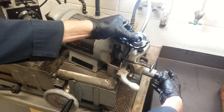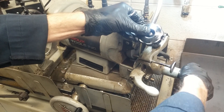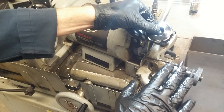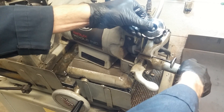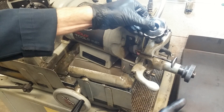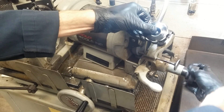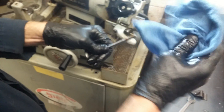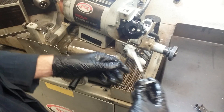You want to move that back and forth across the stone, so I'll move it in there close. Make sure the oil's on the valve. Again, I go slow — the whole idea here is the less material I can take off this valve and make it true, the better. Just barely contacted it, back and forth. I'll back it off so I don't drag it across the stone as I'm pulling it away. Now if I were doing all of my valves, I would do the tips at the same time, but I'm just going to do one valve here and move to the next step.